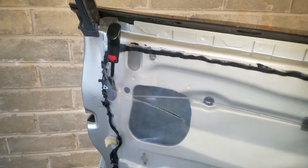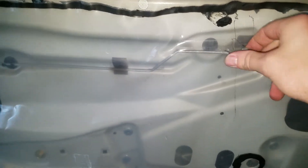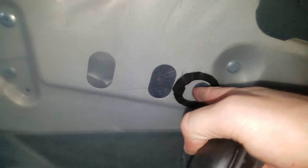Make sure everything lines up, door pops through, all that. The only other thing, and my last piece of advice: always make sure your door is unlocked before you start — pain in the arse if it's locked and for some reason you can't get it undone. Make sure the door handle actuator — that can be a little bit tricky to get in and out. It just hooks on there, so then when you pull your door handle, it puts a lever on that.